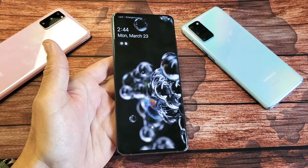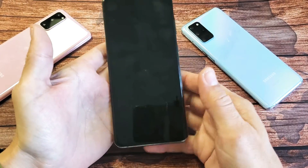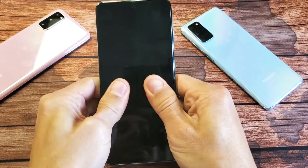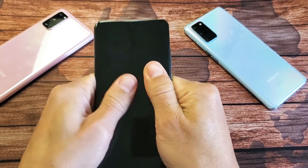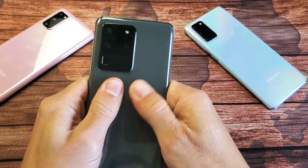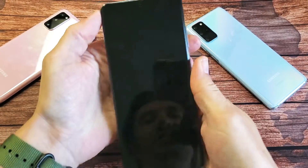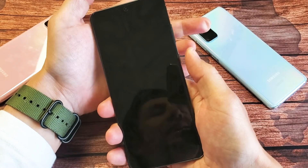If you're not, we're going to the next step. What I want you to do is massage the front of your phone and the back. Pretend the screen is totally black — grab your phone and press kind of hard on the display, like massaging it. Keep pushing all over the screen, all the way down. Turn it over and do the same thing on the back — press all around, including around the lens and the very top. Give it some pressure. After you do that, do a force restart again: volume down, power button, press and hold until you see the Samsung logo.